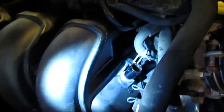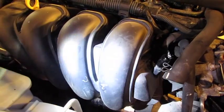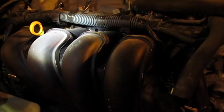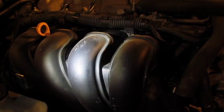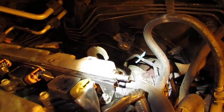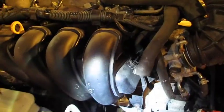This needed to be replaced a long time ago. That oil going into the intake can cause a number of error codes. It can also work against the rubber gasket on the intake, eventually causing the gasket to fail and create additional codes. So make sure you check and replace your positive crankcase valve on a regular basis to prevent a number of other issues with the engine itself.